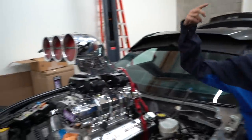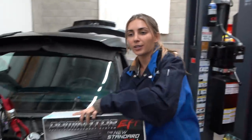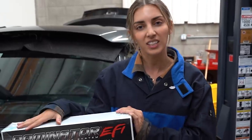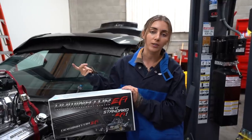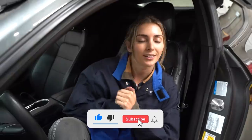I would love to announce that I've partnered with Holley for this build. We're running their dual 4500 throttle bodies and their self-tuning EFI — they fit about eight injectors each, so for our setup we're going to be running 16 injectors total. We're also running their Dominator to control that. I'm really glad we didn't go mechanically injected because with the Dominator and EFI, we're going to have better tunability, especially on the low end, which means better street ability. Hopefully next video we get a first fire. If you don't already subscribe — about 60% of you don't — please hit that subscribe button, share this video with a friend. Thank you so much for watching. E-crew, we out here with love.